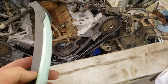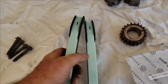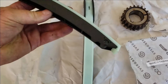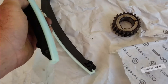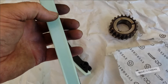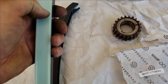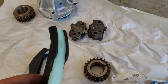It's time for our other guides, and there are two. They look almost identical, but if you hold them side by side, one is higher than the other. The one that has that little ear on it goes on the driver's side. The white plastic faces toward the chain so the chain glides up and down on this plastic. This is driver's side, that's passenger side, with the white plastic facing the chain. Then we'll put the tensioners on.